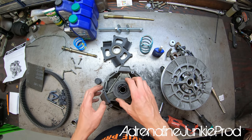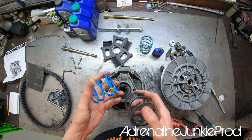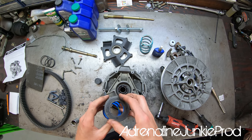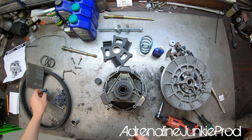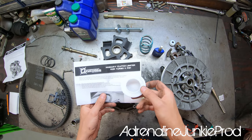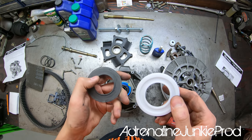With the cover off we can remove all this stuff. Comparing the OEM primary spring to the Aftermarket Assassins spring — they look a little different. We'll also be installing the new limiter washer, which has a groove and lip and is slightly thicker than the factory one. It protects the clutch from over-shifting, which can lead to a bunch of different issues, and the spring fits right in the groove keeping it nicely centered.